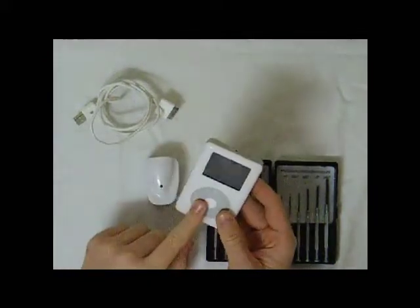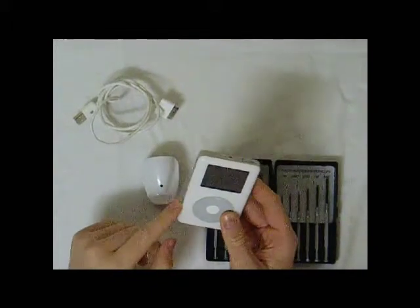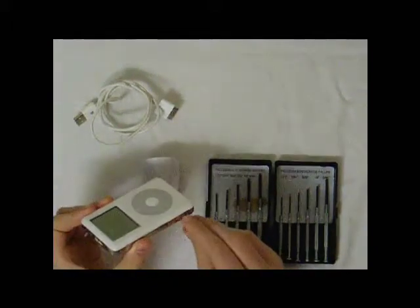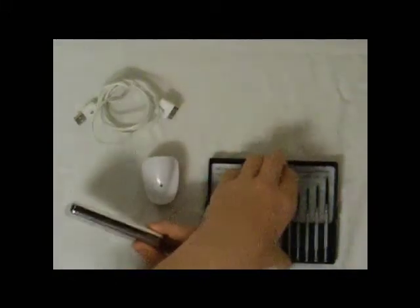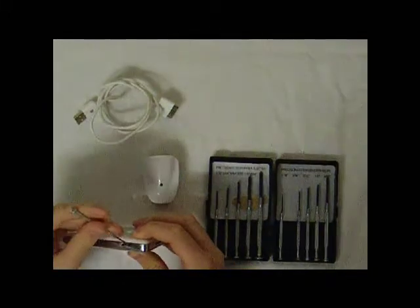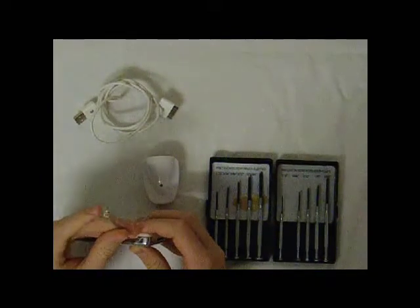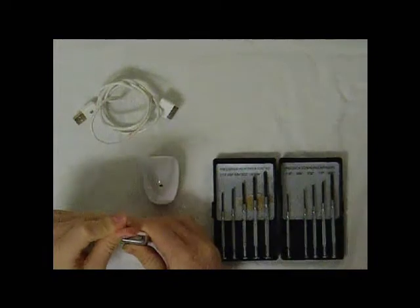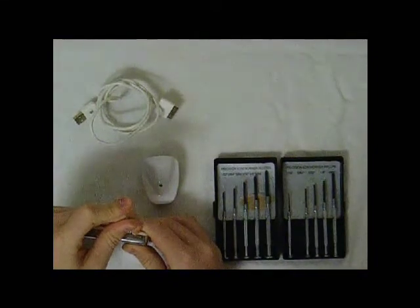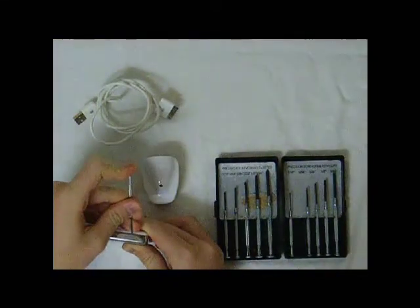Placing your iPod, you want it on the left side, closer to the bottom than the top, about right here. You want to take your screwdriver, push it in, and be careful here because if you slip, you will scratch the chrome pretty badly. You should feel it click in there, and then push it down.